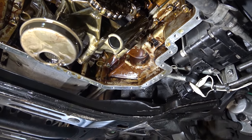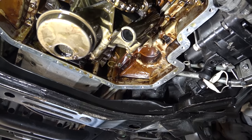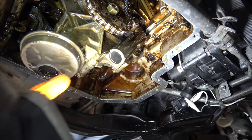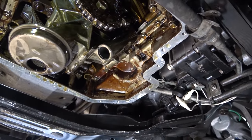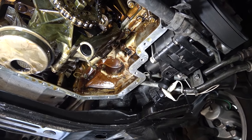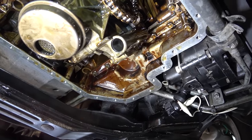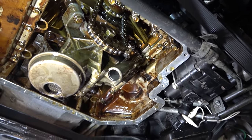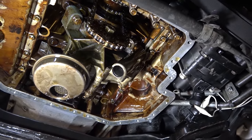I believe I found the issue — I thought it was something electrical or a false alarm, but nope. I removed the oil pan and there's a valve here that regulates the oil pressure, and that thing is stuck. What happened is I used brake cleaner to clean things up a bit before I put the oil pan back, which washed out all the oil in here, and then it seized because it needs to be lubricated in order to move up and down. So now I'm going to see if I can remove it, clean it up, lubricate it, and that should fix the issue. Pretty frustrating but yet another lesson learned.